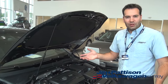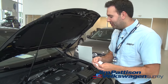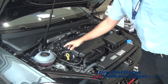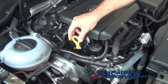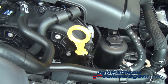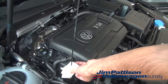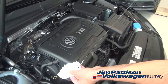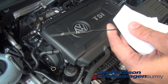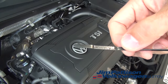The second thing — and one of the most important things — is checking your engine oil. I've got a towel here and I'm going to show you how we check the engine oil. This yellow tube here is called the dipstick. When the engine is off, grab a hold of this and pull it all the way out. Take your rag and wipe off any excess oil on the dipstick so it's nice and dry and clean. You can see here — if we zoom in — there's a little bit of cross-hatching there on the dipstick.